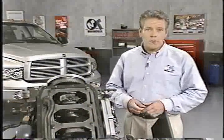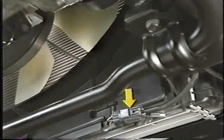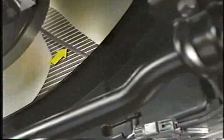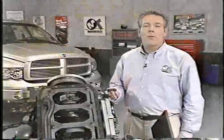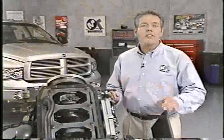There are a couple of items to be aware of when servicing the new fan or adjacent components. First, the fan blade and drive assembly is now right-hand instead of left-hand thread. Second, it is critical to route the fan wiring harness correctly. Failure to do so can cause the wiring to contact the fan and cause damage to a number of components.